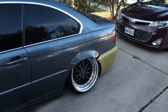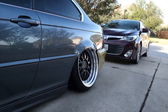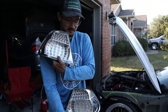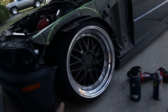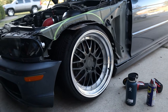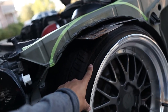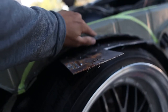This is my car right now — it's tucking 10 and a half in the rear, this is negative 10, 11 camber. The front clearance, there's OEM, but for the front this is 10 and a half as well. It's 18 by 10 and a half, negative 8 camber, offset is plus 2. My tire is a 225/35/18, and on this setup I kind of rub the top of this arch.